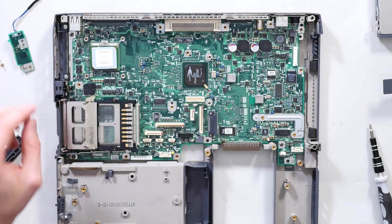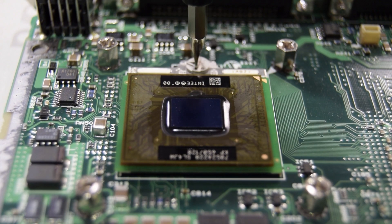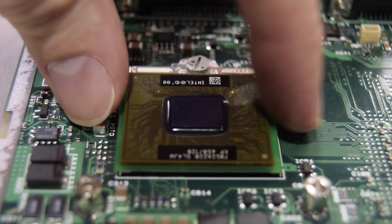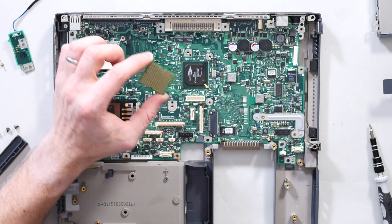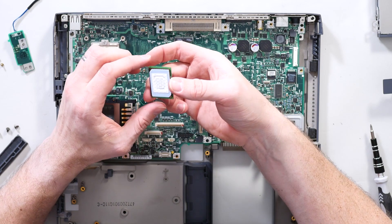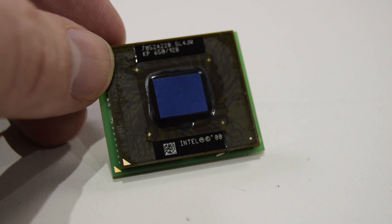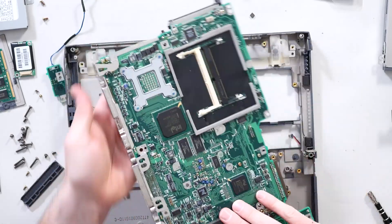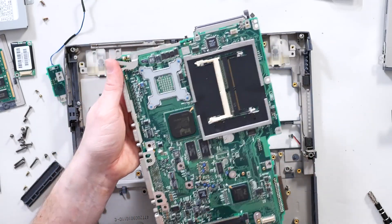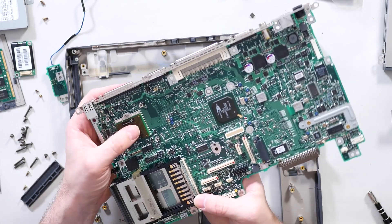Just this thin pressed aluminium sheet on top — you can see the ducts on the inside for fin dissipation. And down here — a socketed CPU in a laptop. I can't explain to you how unusual that is. You never see socketed CPUs on laptops. This one is a Pentium 3 800 MHz. And there she goes. A pair of USB ports on the back. Intel 815EM — so that's your north bridge, your chipset. That makes sense being quite so close to the CPU.